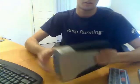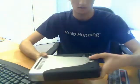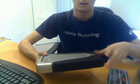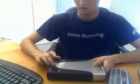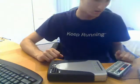Okay, so what was really confusing me when I was trying to take this apart is that I didn't see any screws. There is a screw right there, but it had tape over it, and it said like void if removed. So I was pulling on this, and I was like, this black piece must come off, but it really wasn't working. So finally, I pulled off that tape and realized how clever they were, because you need to take out this screw that was underneath the tape to get into the hard drive. So they know that I opened it.